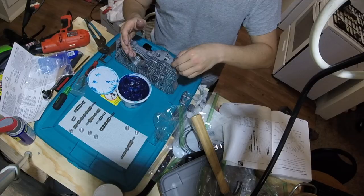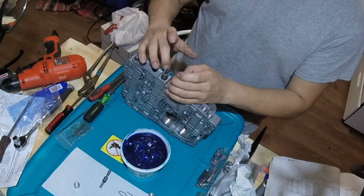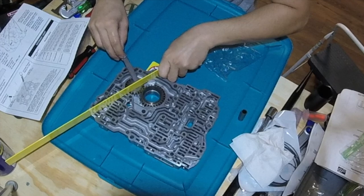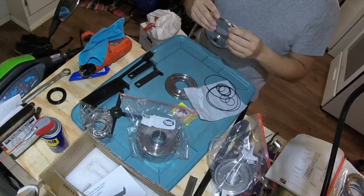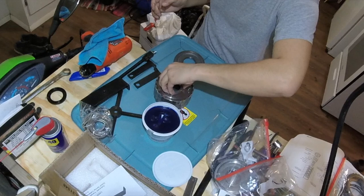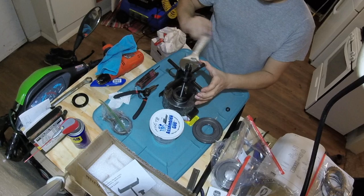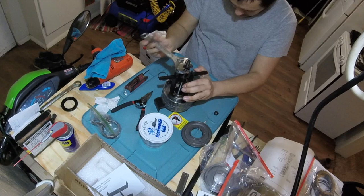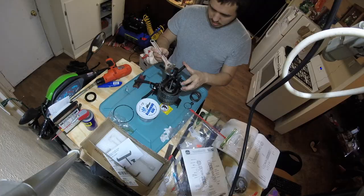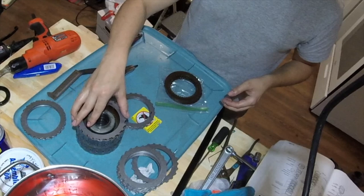Put the clip in and make sure the plug is backed out against the clip. Then put the other valves in. I also checked the pump gear clearances using a feeler gauge — not the best way to do it, but I don't have money for a good depth micrometer. It worked okay, and that's it for the main valve body. Now, the clutches. New O-rings on the pistons. Then compress the spring with the same tool and put on the snap rings. I sanded the end plates with fine grit emery cloth to rough them up a bit. Then in go the steels and frictions that have been soaking in ATF, followed by the end plates and snap rings.